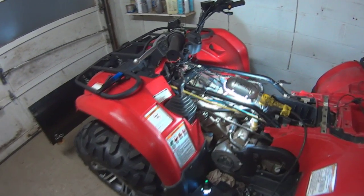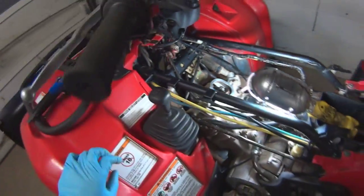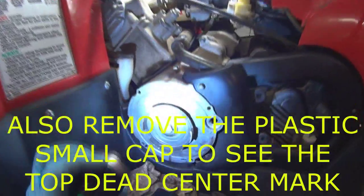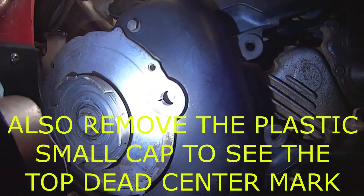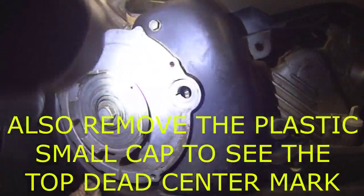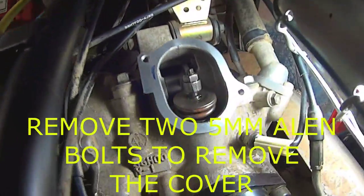The quad sat for two days after I washed the whole engine bay. I let it dry really well — like I said, you want to wash it before you do anything so you don't put any junk in the engine. Next thing, you've got to remove this cover and everything to get to this bolt and spin the engine into the top dead center position. You'll see a mark in there. Then you want to check your valve adjustment.